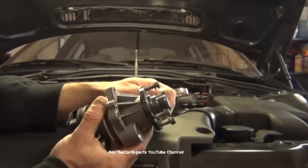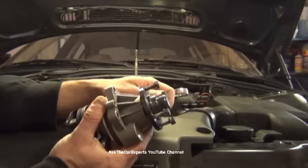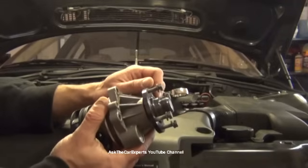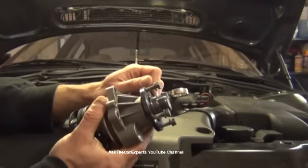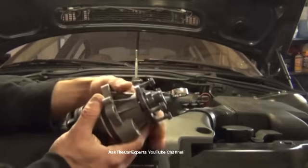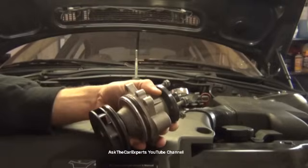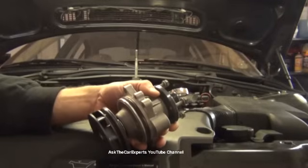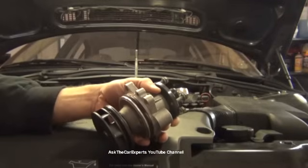Usually you'll need an engine at that point because the sleeves and the cylinder head can lift, the block can warp, the head can warp, and the material actually breaks down. They do have some kits that you can use to fix it if the head bolts start to pull out, but if the sleeves are lifted or the block is warped, then you're already at replacement of an engine.